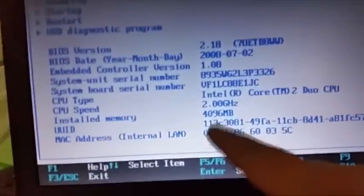These palm rests can be a bit difficult and cumbersome to get down. I'm going to apply some power and see if the machine is working. Three, two, one — smoke test. I think these work better when plugged in. Of course, I took out the battery — three, two, one, smoke test. F1 to enter BIOS, and there we have it: 4,096 megabytes. That is how to upgrade the memory on a ThinkPad R61.